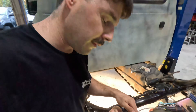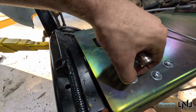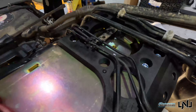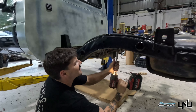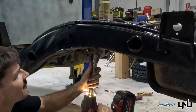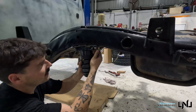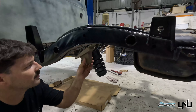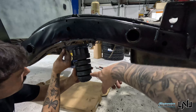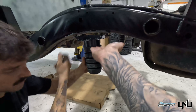Something we found out with these coil tower brace kits — the bolts are the wrong way around. You want the bolt head to the arm and the nut on top. These ones don't affect your coil. We're doing extended bump stops, and these bolts are literally famous for snapping. This is like an 80 Series bump stop — basically just an extension for a GU. 25mm bump stop, and these are called progressive bumps: when you apply pressure on the bottom, they progressively close.